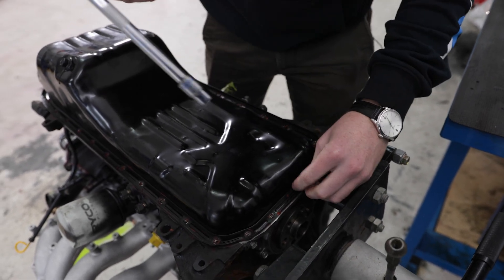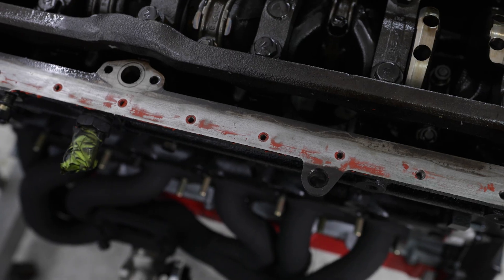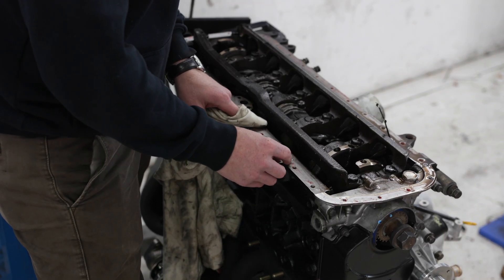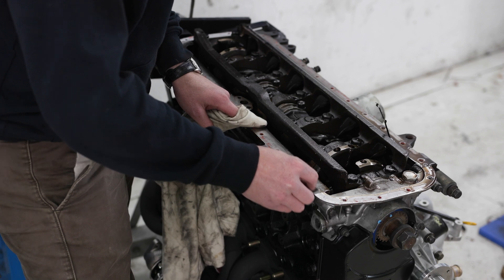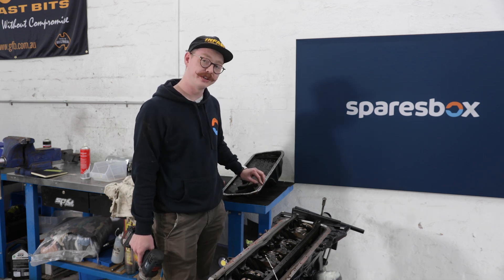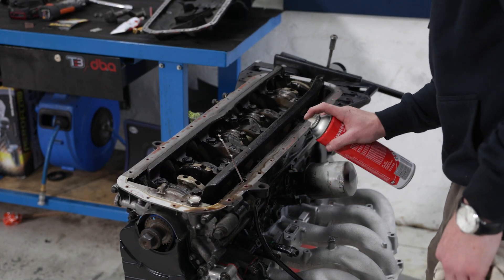Before we can go ahead and do anything, I've got the sump off and it's important to make sure that the mating area of the two surfaces is clean. I've already sealed this sump up once before with some RTV, so there's a couple little bits still left on there and some oil that I'm gonna clean up with a bit of brake cleaner and some elbow grease. There's a couple ways you can take the old RTV off. I like to start with a razor blade getting the larger parts off, moving to a bit of Scotch-Brite or emery paper, just sanding down the surface and making sure it's all smooth and clean. For bigger surfaces, particularly on sumps, there may be a groove for the RTV to sit in. A wire wheel on the drill always helps, but use it lightly — you don't want to damage the surface. Once you've got it all off, a quick spray with some brake cleaner to clean the surface.